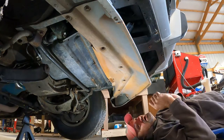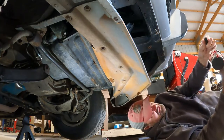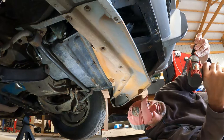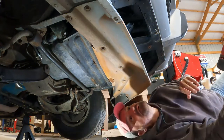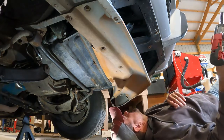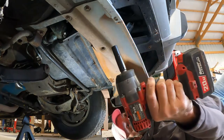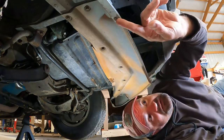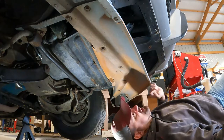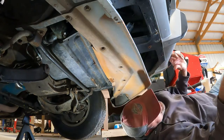On this splitter we've just got a bunch of 3/8-headed bolts holding it on to the side pieces of the spoiler and also to the front framework of the car. Looks like twelve total. We've got some little guys down here - that one's gone so we'll have to replace it with a little quarter-inch guy. Going to grab a driver and take that out first.